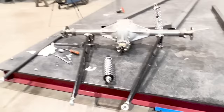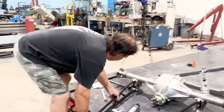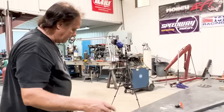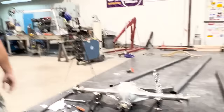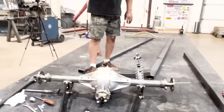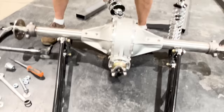You can see it tapers in. I'll determine the spread at the back which will determine the spread at the front - it'll be a little bit closer. The drive shaft will run down through here and mount up close to the back of the transmission, which is what Ed's did. The problem nowadays - and forever, not in 1938 when Ed did his - we're going to use coilovers instead of a buggy spring. There's just no reason for us to get that authentic. Ed had tube shocks, and we're going to use coilovers but they'll have the springs on them. I'm still going to use the crossmember in the same place as Ed's, but Ed didn't have all this big housing, so it presents a unique problem.